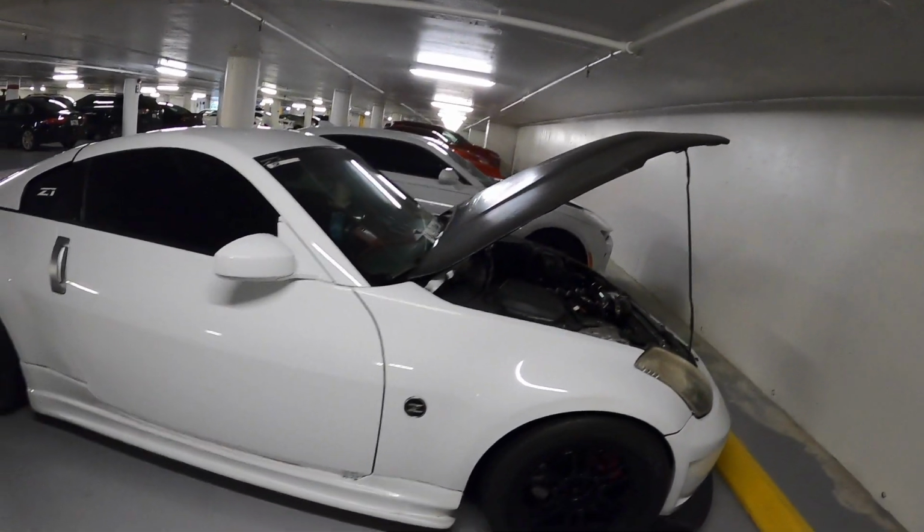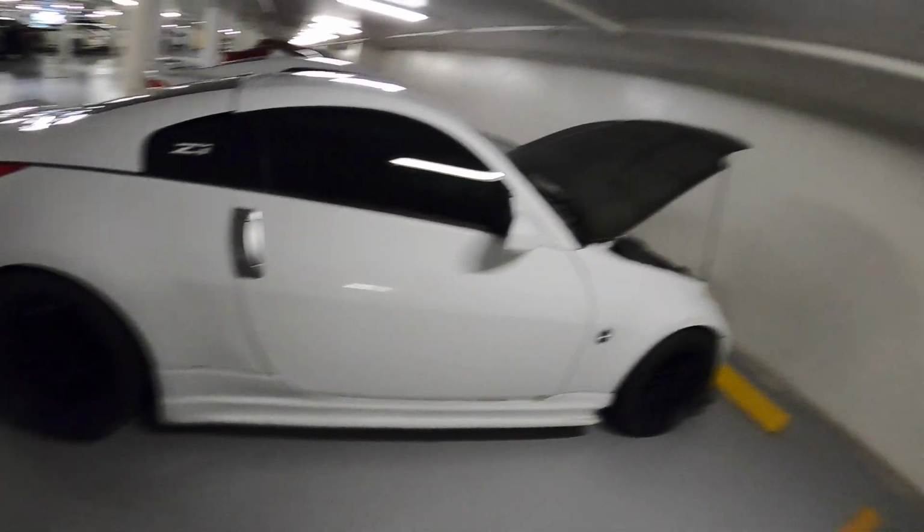And today I got a good video for you guys. Today I'm gonna be taking the Z to the dyno, and I'm gonna be getting retuned because right now the car is currently running a little lean. And also, I gotta get tuned with the new exhaust and with E85 because I have my flex fuel sensor hooked up. So now I'll finally be able to run E85. I already had lines, fuel pump, injectors all ready for E85. All I needed was that flex fuel sensor.